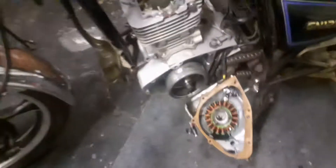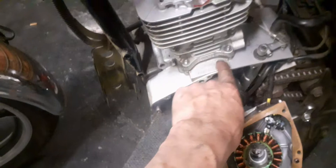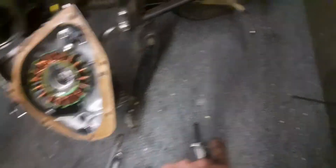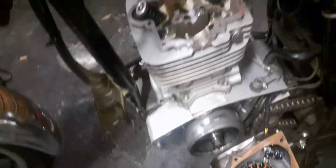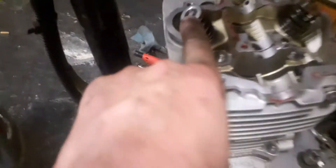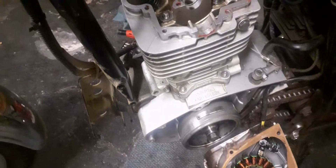I've seized the bloody crankshaft. I loosened up the four dome nuts - there's four of them - and the timing chain tension is loose. Let's remove the barrel and see what's cooking over there. I can see the valves haven't dropped, they're still in place. Let's remove the head and see what's going on.